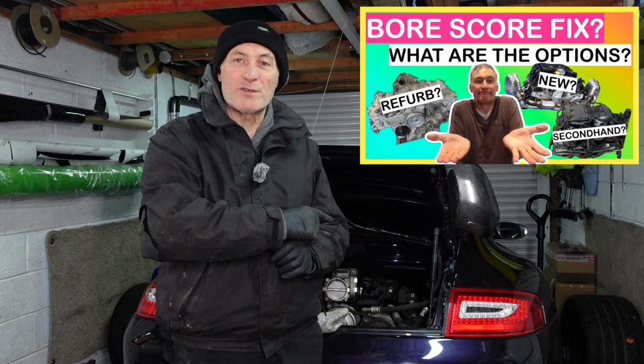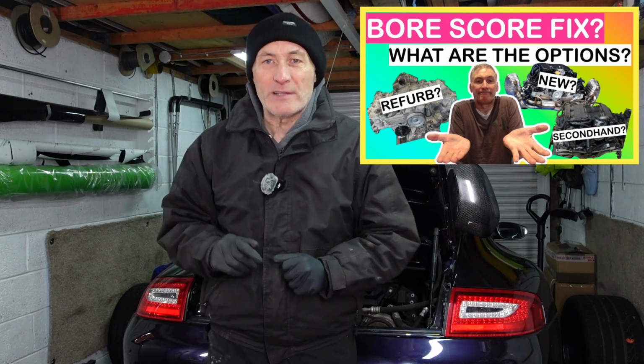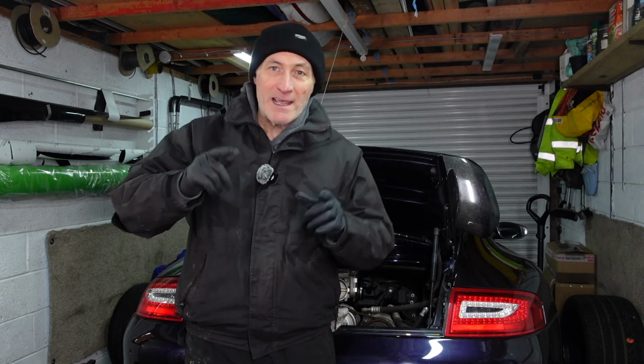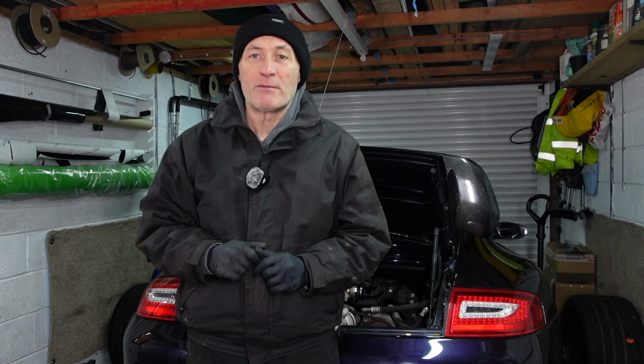But as I said in my video on what options you've got when you've got bore scoring, I'm just going to ignore this one and do it at a later date, and just put some thicker oil in to hopefully help slow down the bore scoring process, and I'm just going to carry on as if I haven't got it. And today we're going to get back to that major service that I was going to do until I found I had bore scoring.